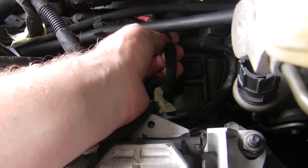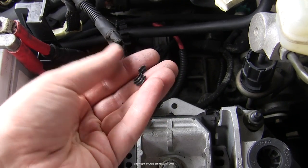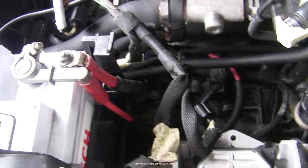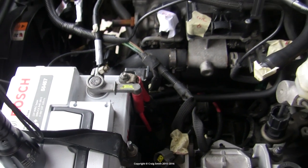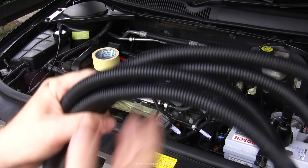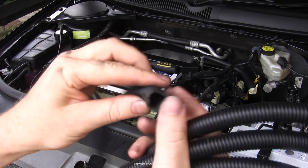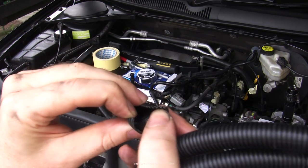All I'm going to do in this video is replace the conduit. It's really easy, but it might look a little intimidating when you can't tell how the joins are done, or if you're thinking you need to disconnect cables to get the sleeve on. You can get this protective sleeve, which has a split down its side, from auto electricians or online - I'll add links to Amazon - and it is peanuts cheap.